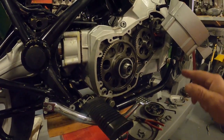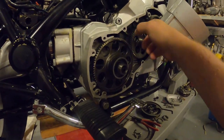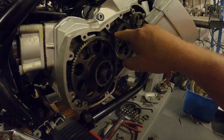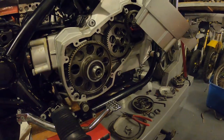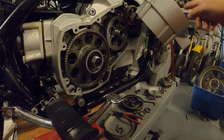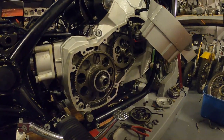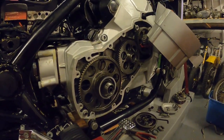My goal is to put this back together. I'm going to use assembly lube on these gears since it's dry — I don't want to bust these gears. That's a fine machined gear and I'm sure it's made out of unobtainium. With assembly lube and everything back together, we're going to turn the motor over and use our Wankel compression tester, which I will show you, and see if we can get a picture of both rotors and each peak.